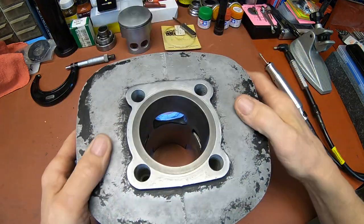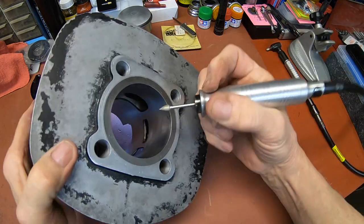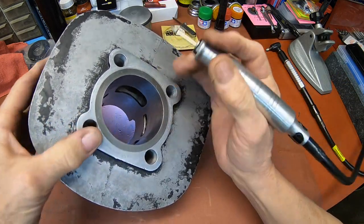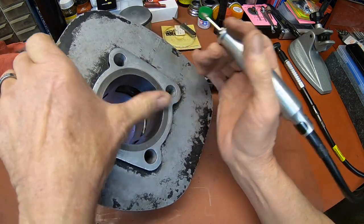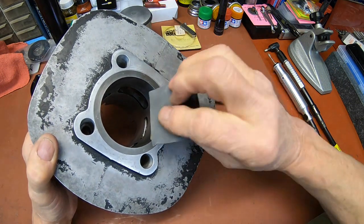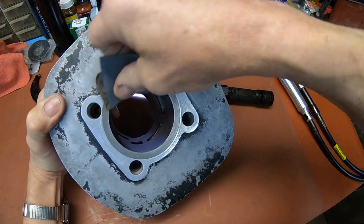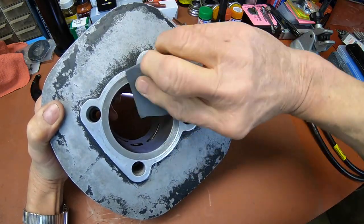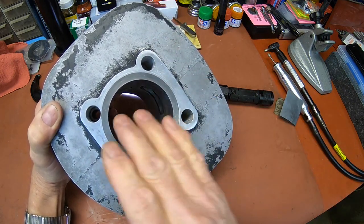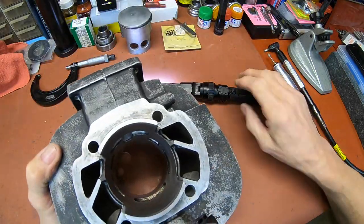But that's the other thing you want to do. I've already done this, so I'm not going to do it again, but go around the top here and just clean that up. And then once you've done it, I like to go in with some 400 grit sandpaper and just smooth that up. And again, if you can feel that sharp, if it's sharp, it is, and you need to take care of it. Then we go to the bottom,